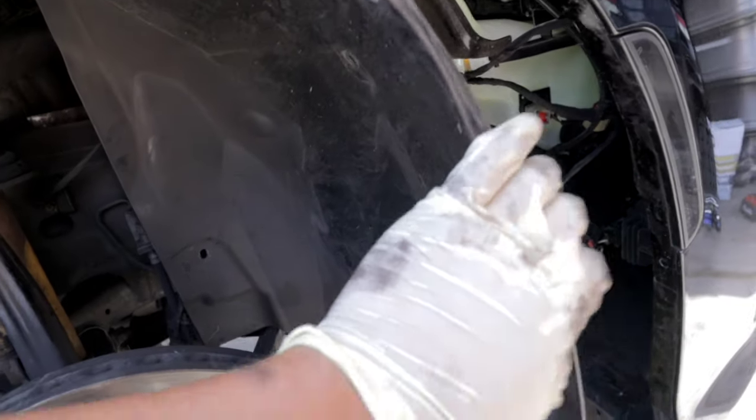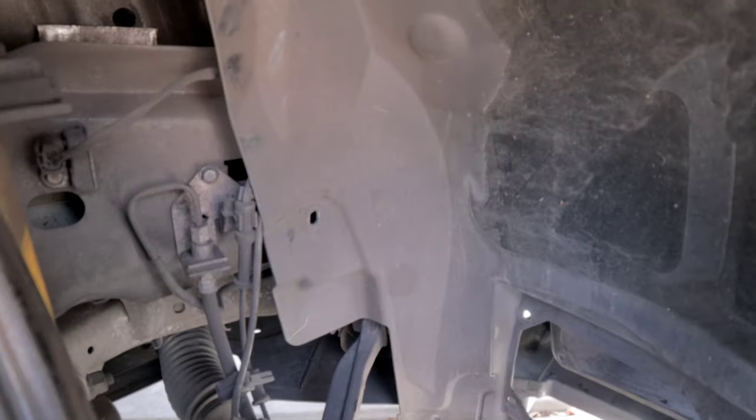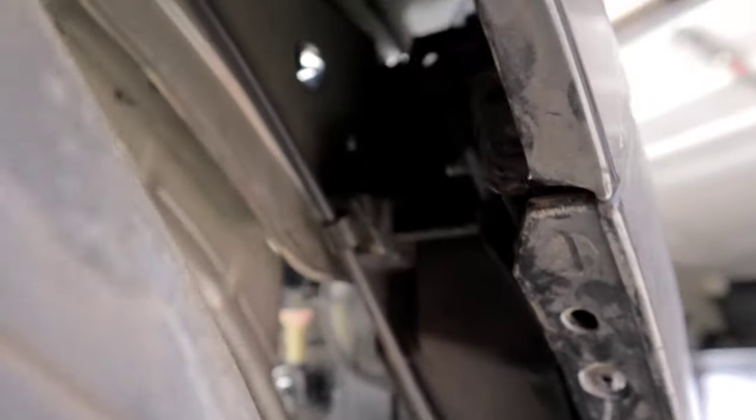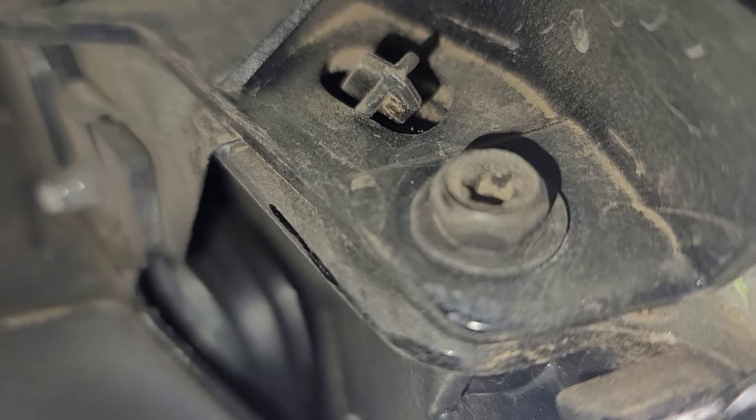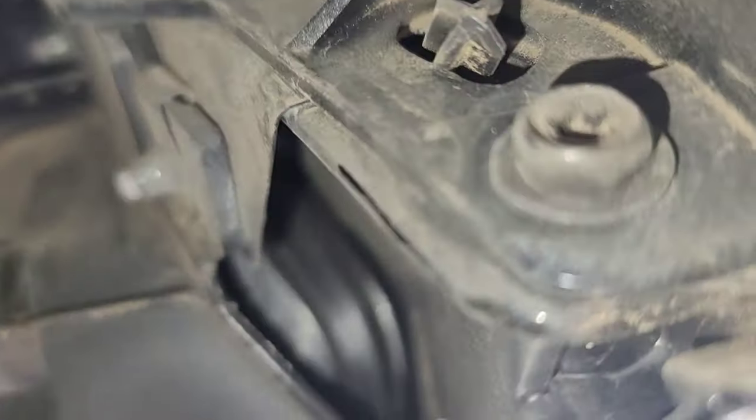What I ended up doing here is just removing the whole front portion of this wheel liner. As you guys can see, I have all the plastic clips removed and set off on the ground. This is going to make it easier so that you can get access to the two fasteners that are holding the bumper on the top up there. There's one right there and one up there. So you'll remove both of those guys